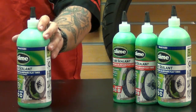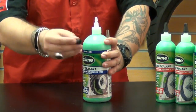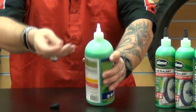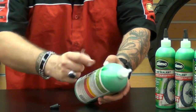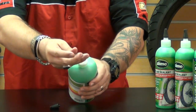It's available for tube and tubeless applications and extremely easy to use. It comes with a core remover for your valve stem, so when you get a flat tire, you remove the valve core, get all the air out of the tire, take this tube, put it on the nozzle, hook the end of the nozzle to your valve stem, and then on the back of the tube it has an application chart telling you how much fluid to install depending on your tire or the application.